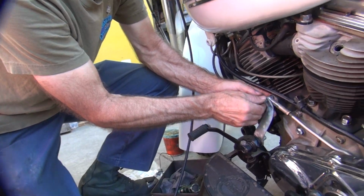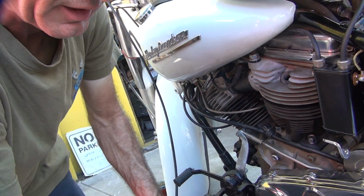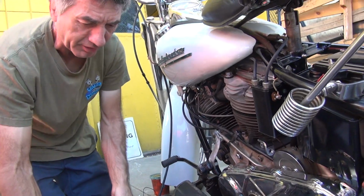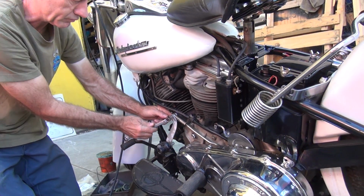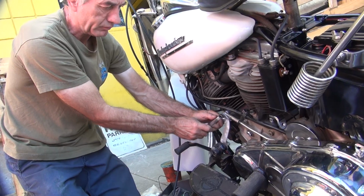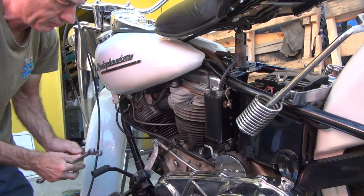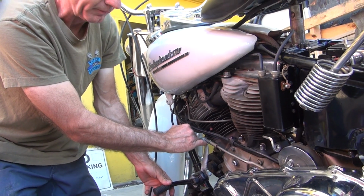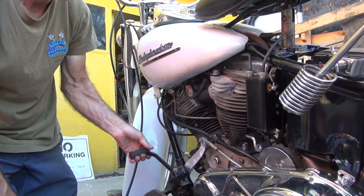Okay, so this does not have any kind of a lock washer on it, which is nice. It's a suicide shifter. Yeah. 9/16 on that side. See, no binding. Big difference. See, I was hitting over here before, because they didn't do it correctly. Nice. The cable's up and out of the way too, see?